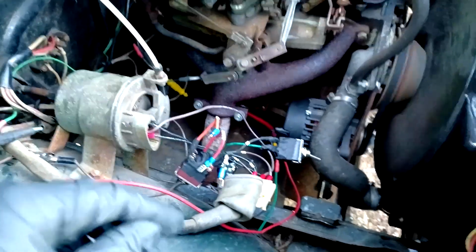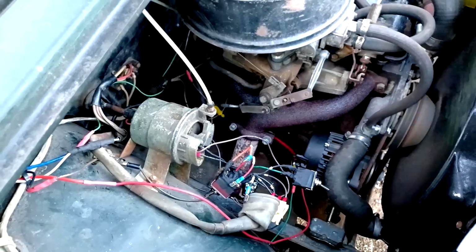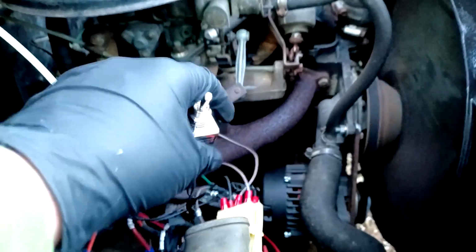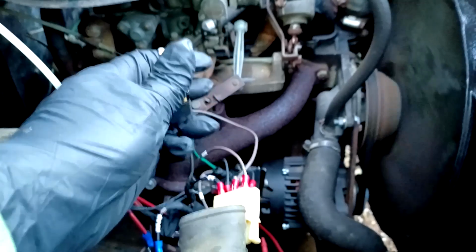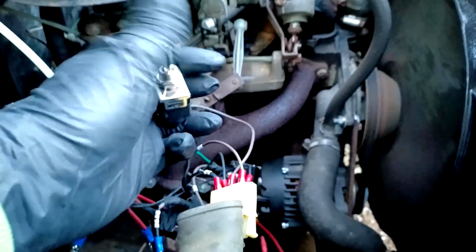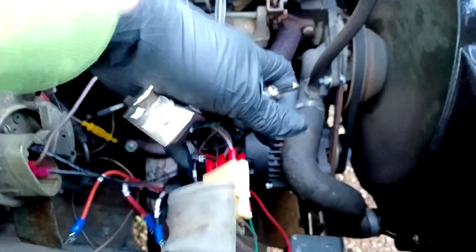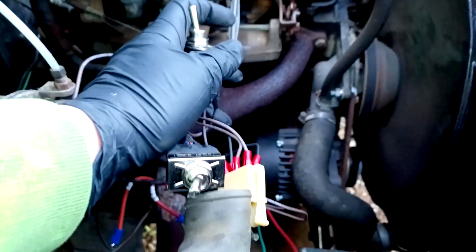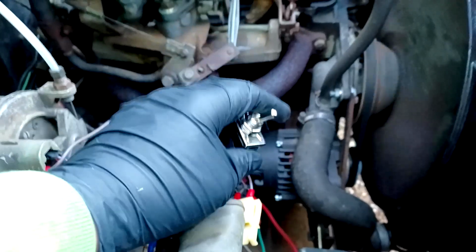You'll see. Okay, put it in drive. So it's in first gear right now. It's in drive, and drive is always first. Nothing controls first other than the box itself up front. So let's go to second. You see the detent went in and out. Since it went out, we know it's in another gear. Second, has to be. Now let's go for third. Watch the detent. There's third. There's second. You get rid of second. There's first. There you go.